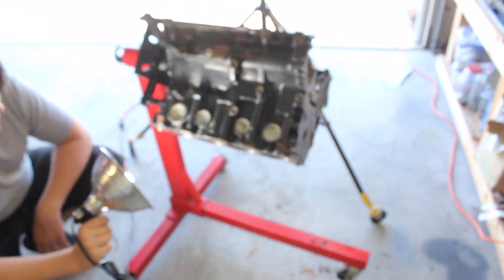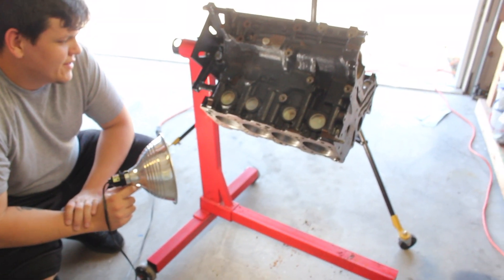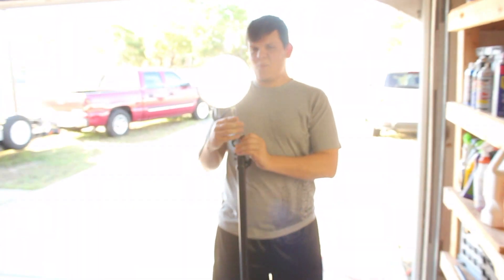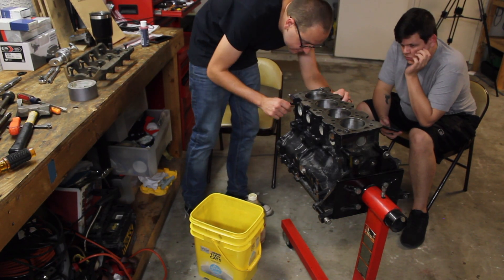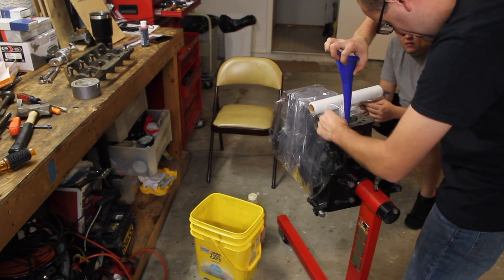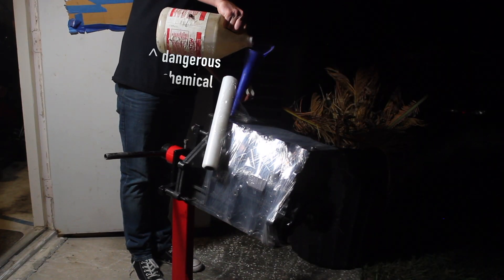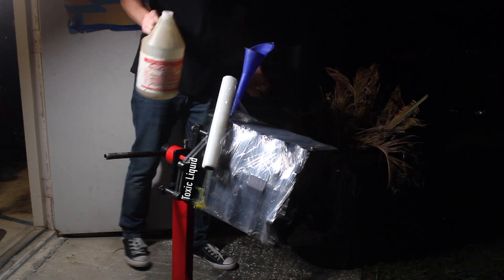The plan is to give it 3,000 miles and then tear it back apart because I'm going to have to redo everything with new pistons anyway, hopefully at my next power level. Because of all the rust in the engine block, I'm going to try to use muriatic acid to dissolve it, then rinse it out with water. I'm pulling the engine block outside because I don't want to inhale any of the fumes. I'll let it soak for a bit and try to contain the muriatic acid so it doesn't get on anything and ruin it.